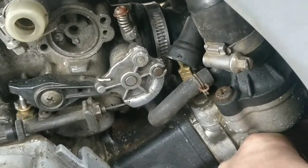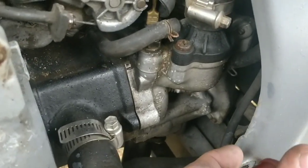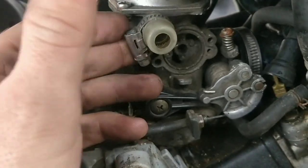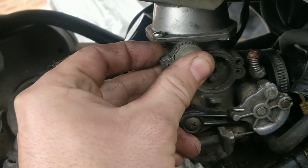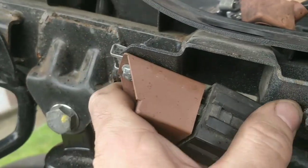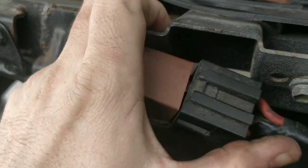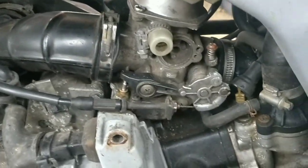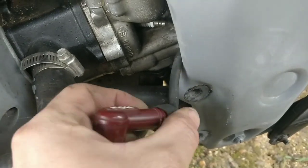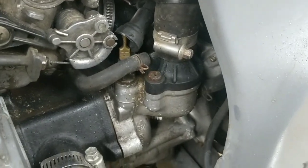For now let's check we've got some spark. The spark plug doesn't look happy — the lead looks too bent. We'll check, we'll clean the spark plug wires, we'll clean the connector here, we'll clean the coil leads, and then we'll go back to a straight start up. We've taken the bucket off here and we're just going to look at the connections. There are spiders in there! All these old connectors are the stuff we need to look at — we've got brake cleaner, we'll give them all a bit of a clean. Now we need to find the actual coil wires — they're probably most important at this stage.